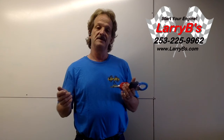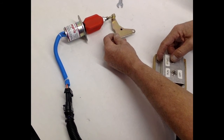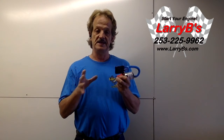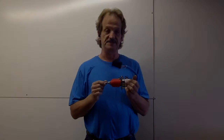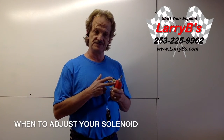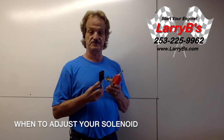You're ready to go. Turn the key off — this pops out. Hit the starter, it'll pull in. Just tap it, let go of the key, it'll hold in. Turn the key off, it'll pop back up. When you hit the start, the big coil pulls it in, then you let go of the key and the little coil holds it. You turn the key off, it pops back out, shuts the fuel off, and the engine dies. Anytime you replace the boot, put on a new solenoid, or if you're just having problems with it, it's a good idea to check the adjustment on your fuel solenoid.